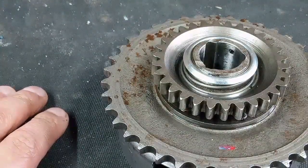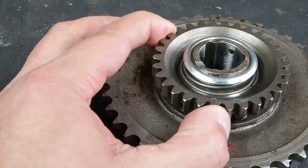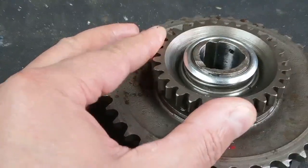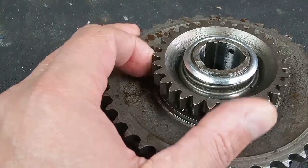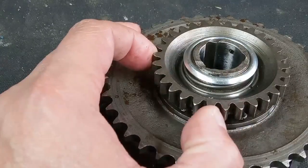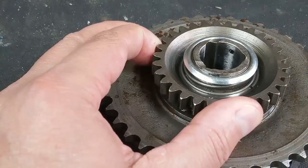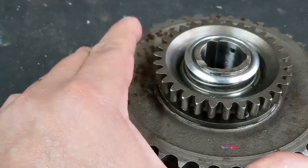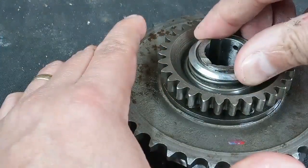you can get sticky Kickstarters, mystery noises from inside the casing, and one or two people say that it can make your clutch drag, which I'm not entirely sure is true, but I can see that extra little bit of resistance could possibly affect the operation of the clutch. But I think largely it affects your Kickstarter mechanism, and you've got this spring rubbing against the bearing, which is far from ideal. So you need to make sure that this is in good condition.